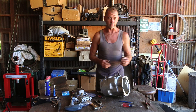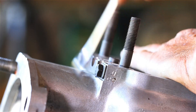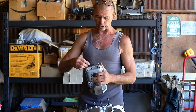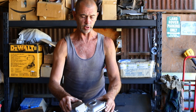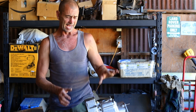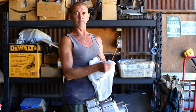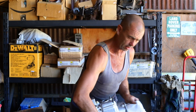We have here a retainer that holds our seals on the selector shafts that I'd like to install now so I don't lose them later on. There's a second one that fits onto the top cover. We still have a seal that we can put into that rear housing we just installed, but I'm concerned it might get damaged. So I'm going to hold off until we're ready to put in the main shaft and the lay shaft and everything else back together. In the meantime, to protect the bearings and for general cleanliness, we're going to bag it up and pack it away.